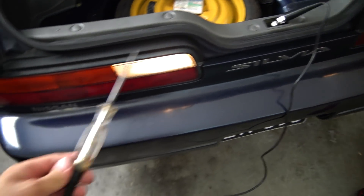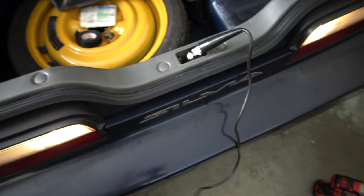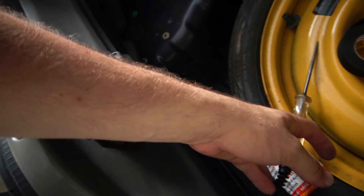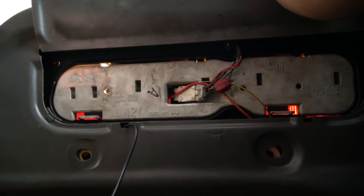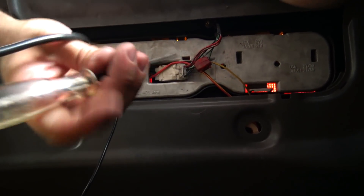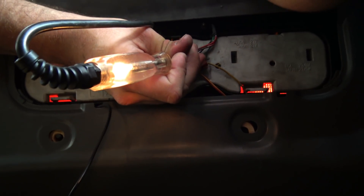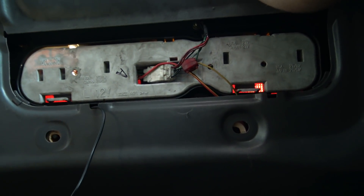We have the car in reverse. This is a test light — I'm going to snap on one but any test light will do. You can use a multimeter but it's probably easier with a test light. So this is hooked up to earth. Now we come on the inside of the car. There's the rear back tail light, so the actual reverse light is over here. The wiring comes out here and all we do is probe the wires until we find the one that lights up. That one lights up — in this case it's a green with a white trace. That's our reverse wire.